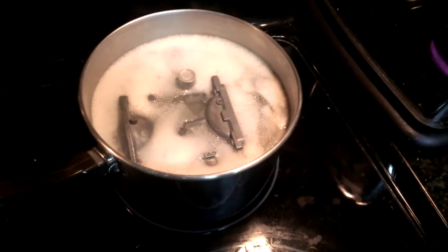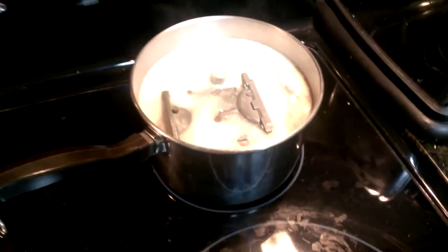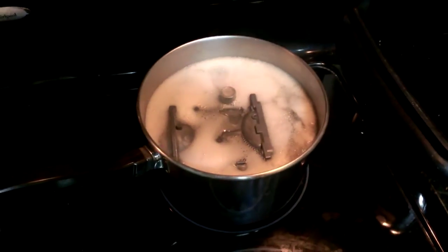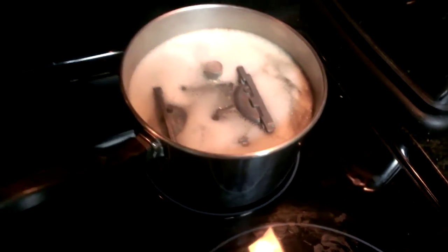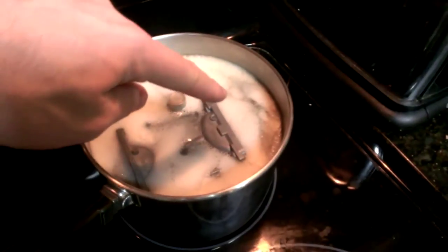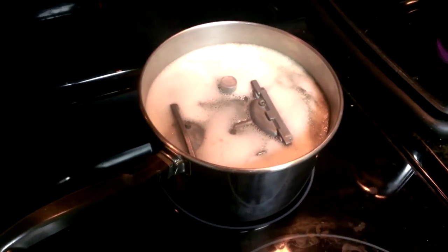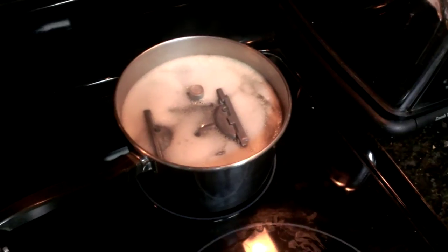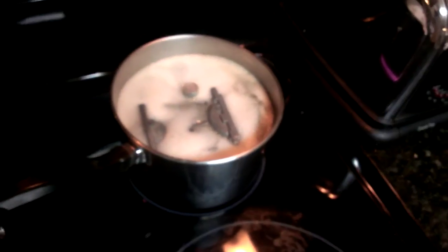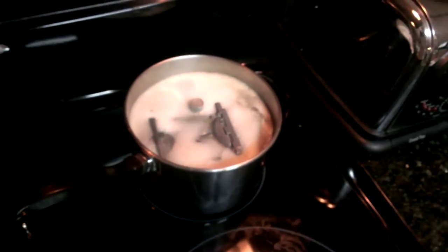Here I am boiling the carburetor in some lemon juice. I didn't have enough to bury the carb in the pot all the way, so I had to mix a little bit of water in there. Just what you're seeing here is gunk that's come off the carburetor — as soon as I put it in there, stuff started to flow, so it's definitely eating stuff off the carburetor. And it really stinks — I can smell petroleum, gas, varnish, and all that stuff, along with a nice lemon smell all combined together. It really does not smell very good.